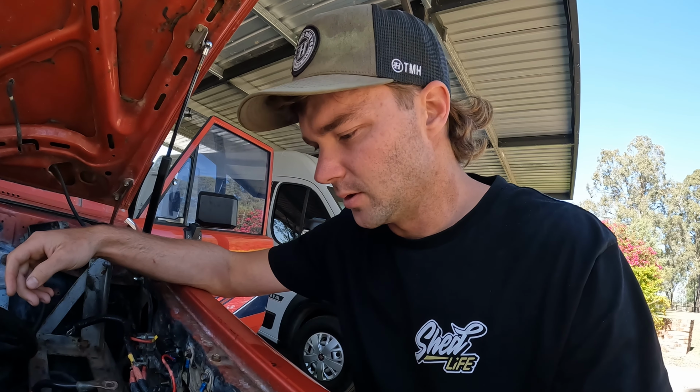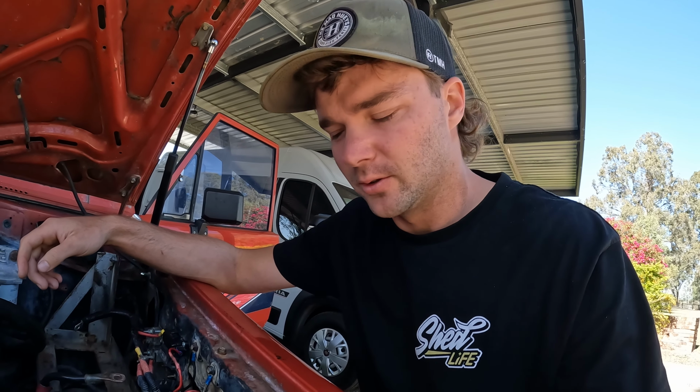Rightio, just sort of calming down a little bit after that. So I just went and got the GoPro, as I wasn't really filming. I've just been trying to work out the glow plug thing, because it worked when I plugged the timer in yesterday for like 10 seconds and then sort of cut out. So just had the multimeter hooked up, just checking if I had the power and everything there. And I was like, it's as if the timer's faulty.